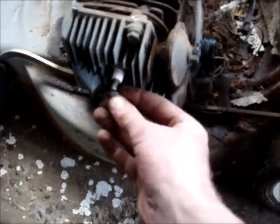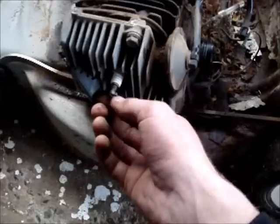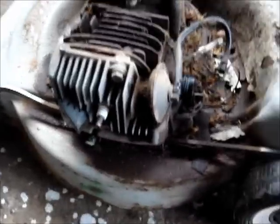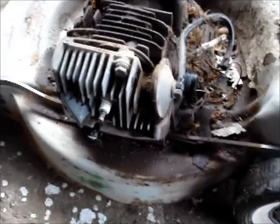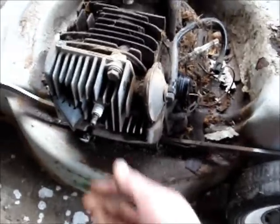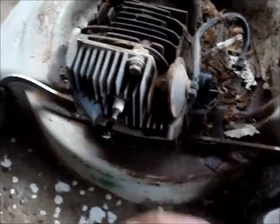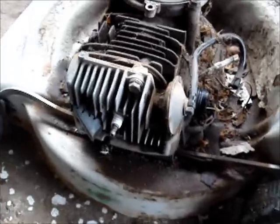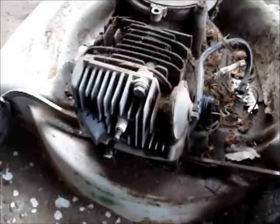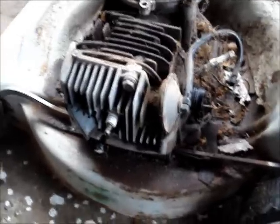Don't like what someone's done for a repair here. Well, they just cut off the end off the original one, put on that thing, and it still ends up arcing across anything, when it's only a couple of dollars for a new spark plug boot. All that's supposed to be in the end of this wire is a screw, and then the boot slides over it, and it works perfectly. But anyhow, I'll have another ignition coil I can just swap on, and she'll be pretty much perfect again.